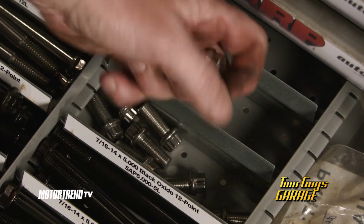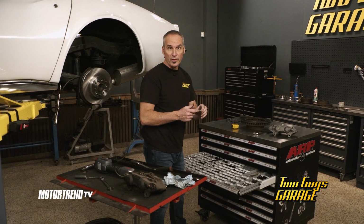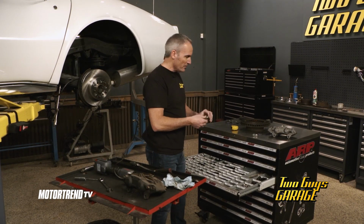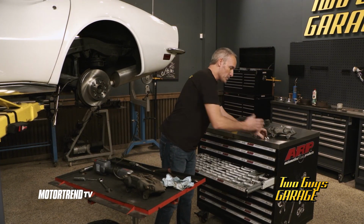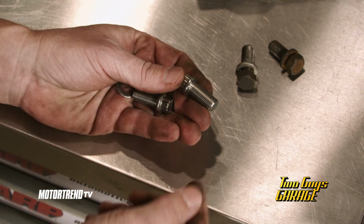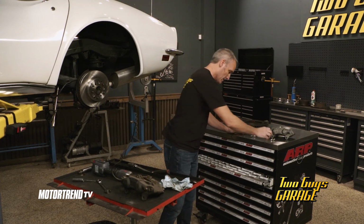Now, these are gonna be about 20% stronger than the grade 8s. That's gonna be from premium material. It's also through hardened instead of case hardened, just on the outsides. And they also roll the threads, which means they press to make those threads instead of cutting machine material away. So that's gonna put a compressive stress, extra strength in there, which is nice.